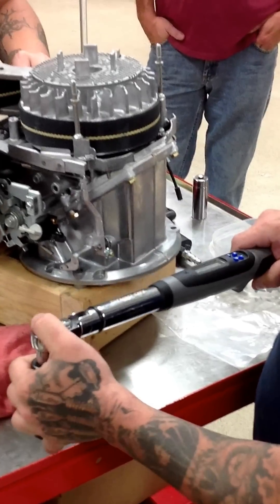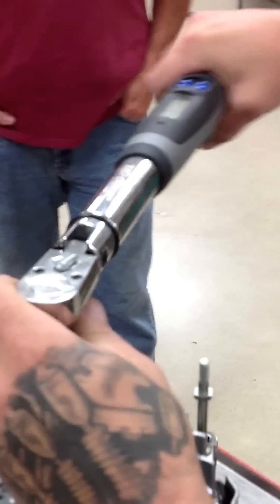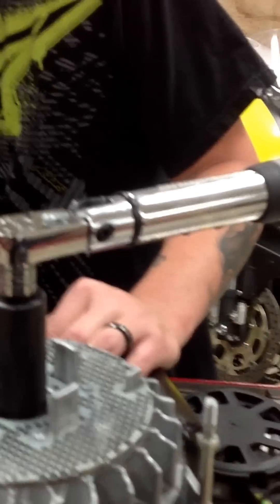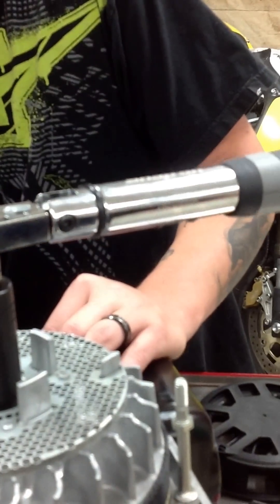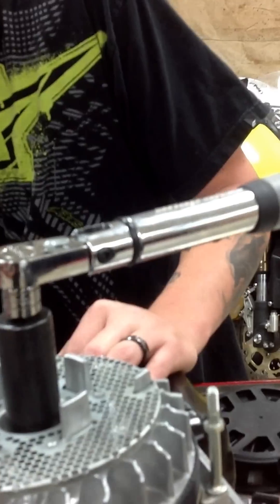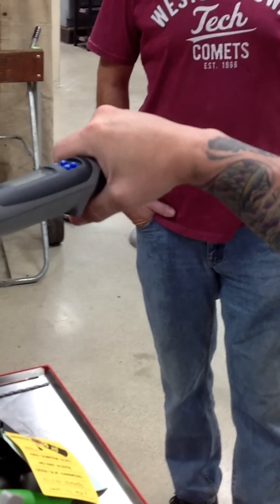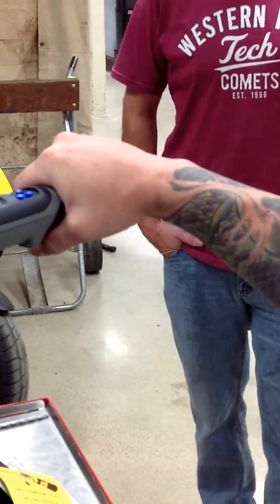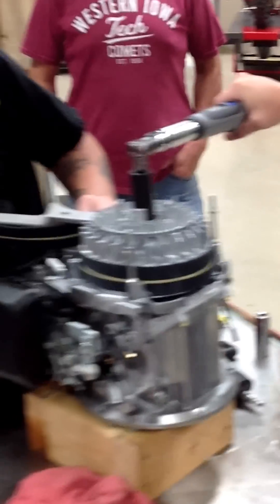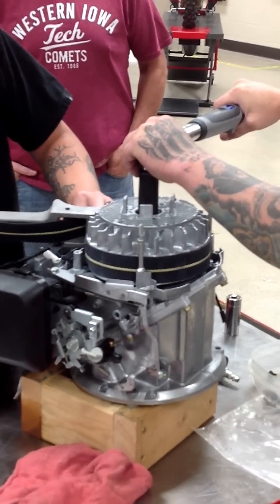Now, as we've shown in some of our other videos, we make a big deal about when you use the torque wrench to go ahead and support the socket and to make sure that this bend is not tipped down or up. We do not want to alter the torque on that — the torque wrench needs to be straight. Also look at his placement: do you see where his thumb is on the thumb lock? You want to make sure that you're right in that spot so that we torque it properly. All right, you guys work together on this — go ahead.